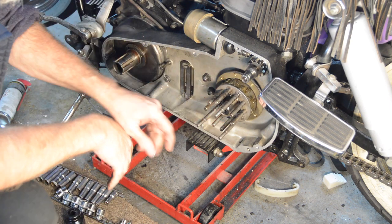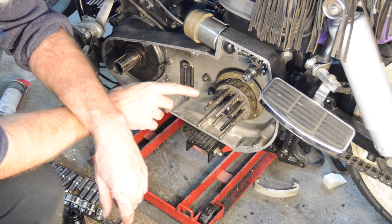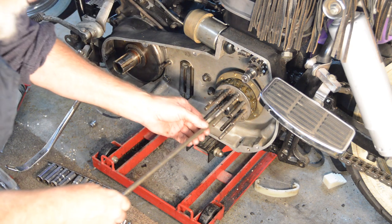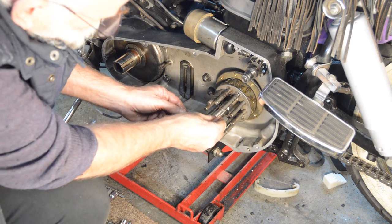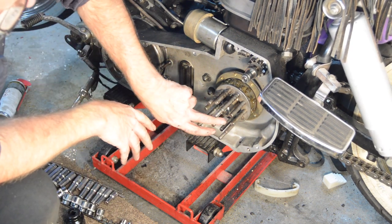Now, after the first video, I was told that the push rod wasn't meant to come out of there because it's attached to an oil plug at the back. Now, my only option is to take the end cover off the gearbox on the other side or give it a go. So, I think we'll just give it a go and hope that nothing's moved. I've oiled the push rod. That's gone back where it was. I'm tempted just to try that because that is where it was effectively.